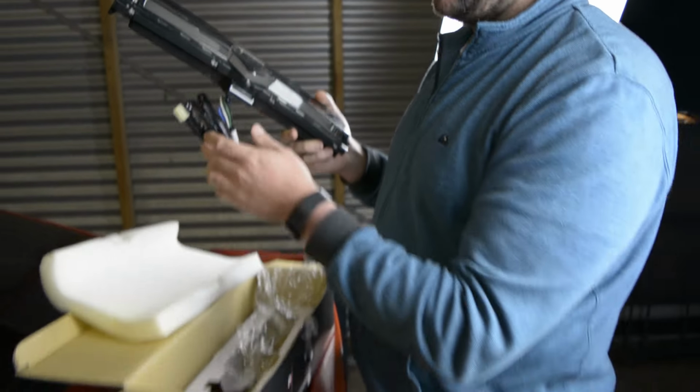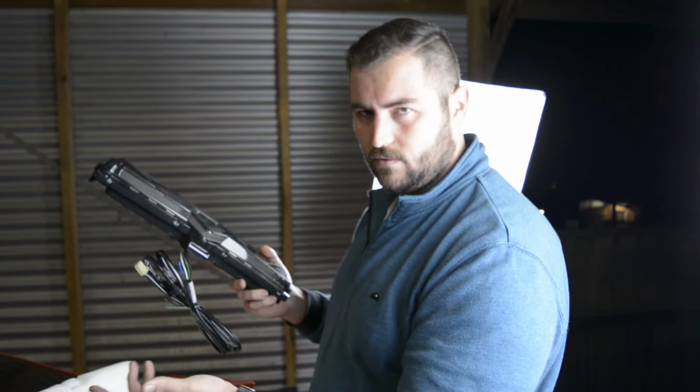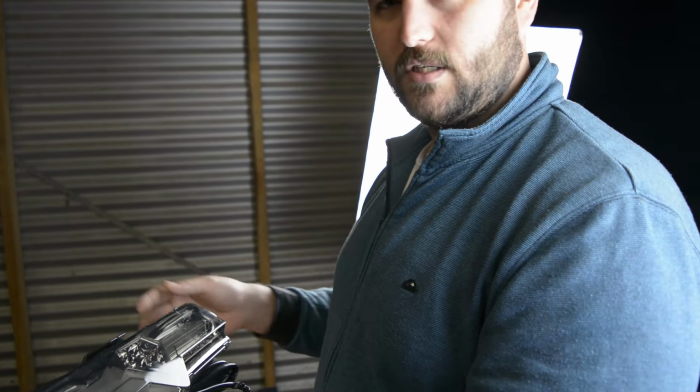The back of your car lights, down here, yeah. So when you brake and when your lights are on, that will power up this thing. So when I said I was running in to get some stuff for the mystery mod, it was basically wiretaps. Wiretaps save you having to cut and solder and crimp wires. You basically just put the two wires that you want to connect together in this wiretap, push down a metal lug, and it makes a connection between the two. So it looks pretty simple.